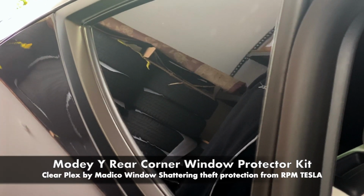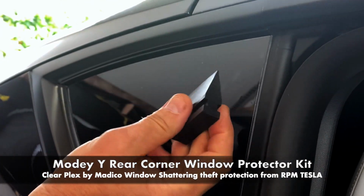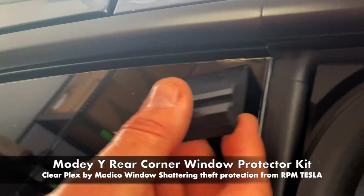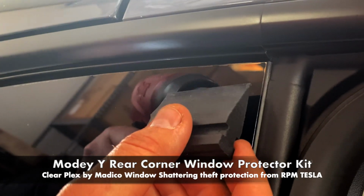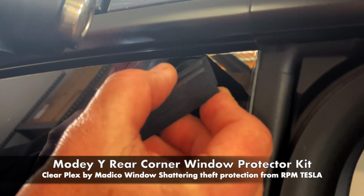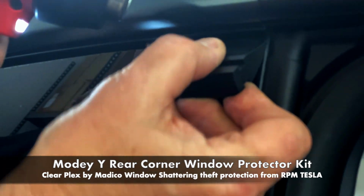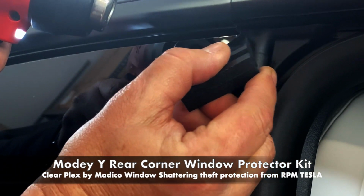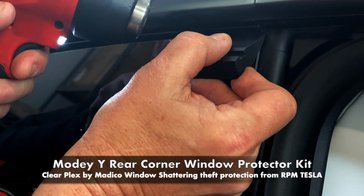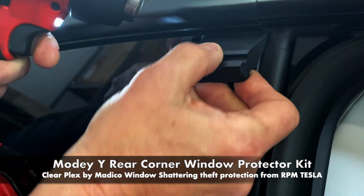Okay, if you let it dry out and it's looking good and you want to touch up any of the edges, this is called a heat down. So take a look at this top edge here. There's a little bit of air trapped underneath the very edge. With a heat gun or a hair dryer, you're kind of reactivating the adhesive underneath. So you just want to apply some pressure and heat it up. And this will remove any small gaps, especially near the edges, that is trapped air. Just heat it up, press it down, hold it.